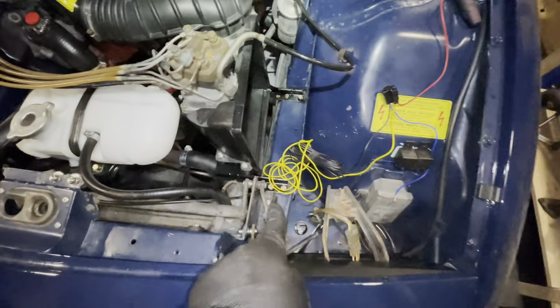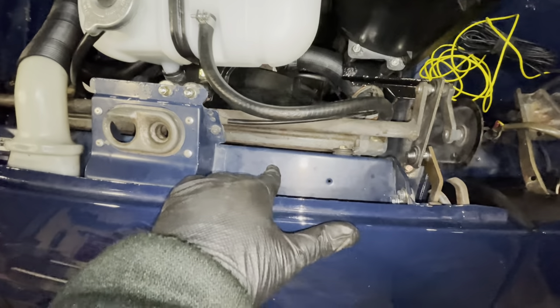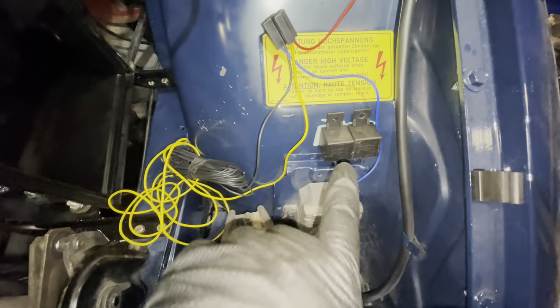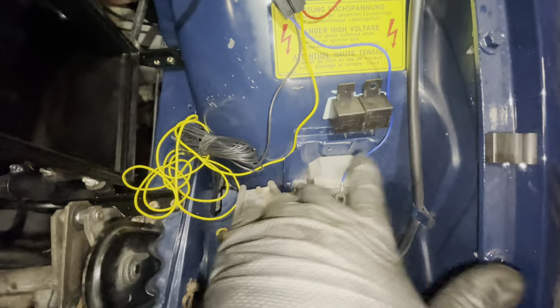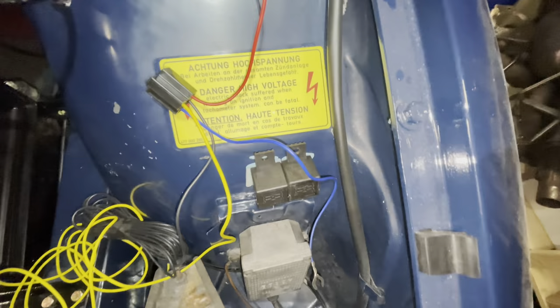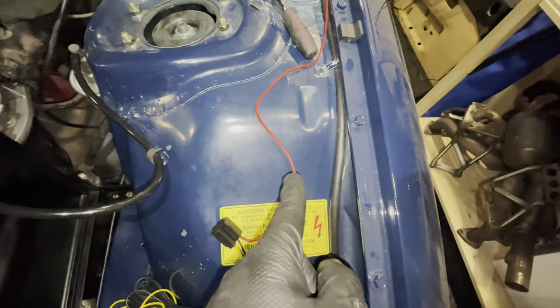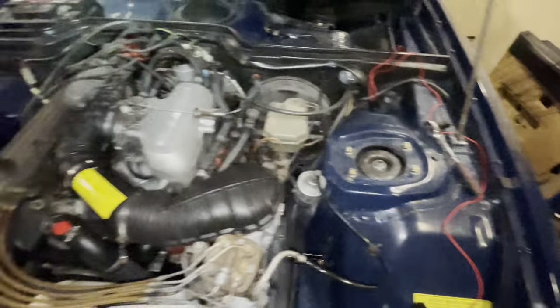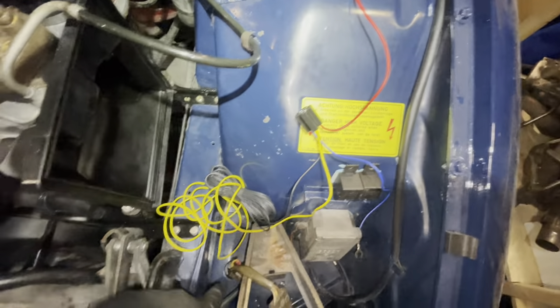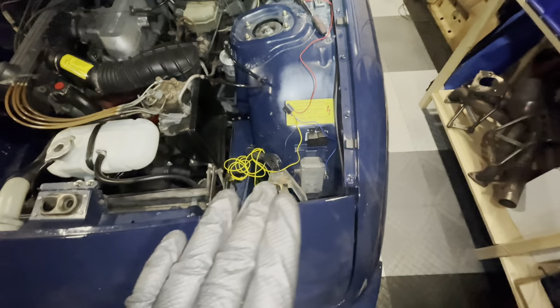So we know that doesn't work. I tried one hole I found and even that one. I considered the earth point down there. But in the end I've just got this tacked in there with masking tape, and I think this is the spot where I need to have them — I'll try to have them symmetrical. The wire loom will come out there and another one there. Most of the wires will go back through here following the existing loom, wrapped in tape so you won't see them — going through there, over here, some into the battery, some into the bulkhead, and some will go down through the car to pop out at the bumper and feed the lights.